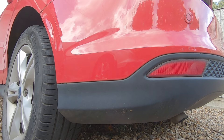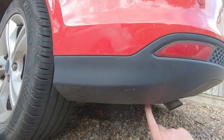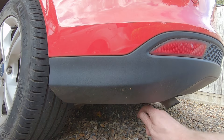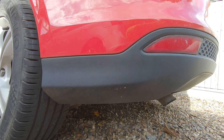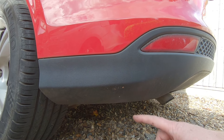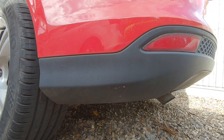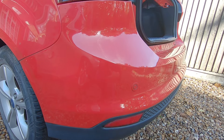...is the vents that are behind the bumper. To check if it's actually the vents leaking, have a little look under the bumper here, right up in this corner. If you look up at the floor here towards the side of the car, there'll be a hard plastic grommet — not a rubber one — in this corner. You pull that out and it'll just pour sort of rotten smelling water out onto the floor. On mine, I've put a hole in it so when I plug it back in, any water that gets in there just runs out of that hole.